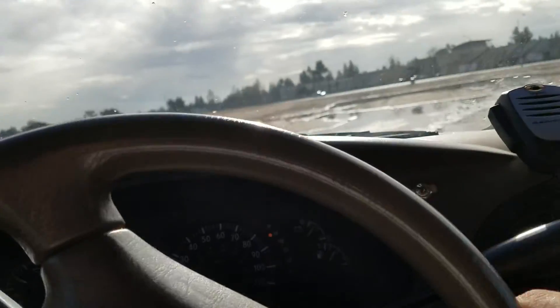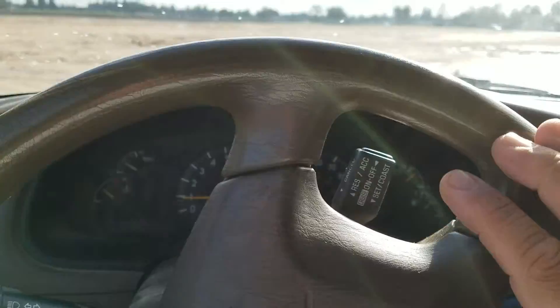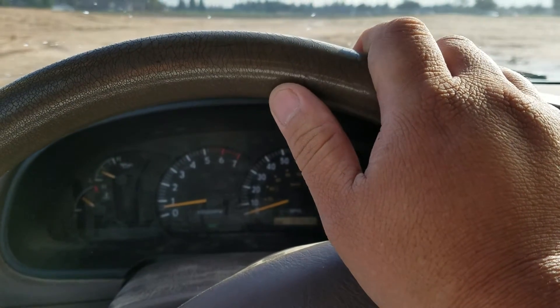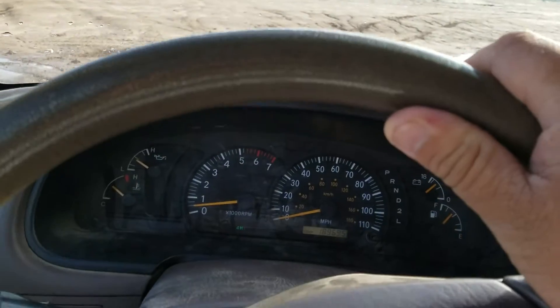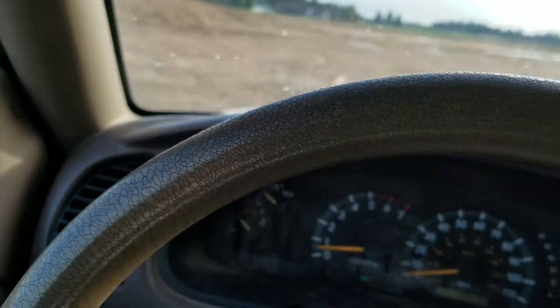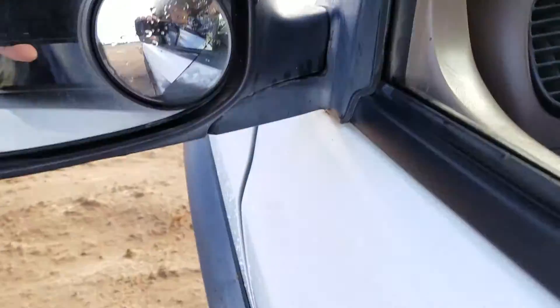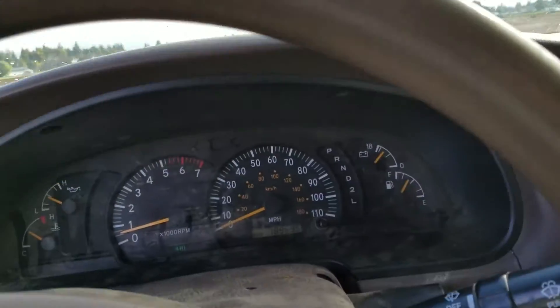Which is okay because that's how it should be. I'm going to step on my accelerator trying to do like a jackrabbit start, but this time I'm holding the steering wheel. It's not that bad — it's controllable. Watch how the dirt's going to get flung on this side. So you see that — that means the driver's side is working and the passenger side isn't working, which is what I wanted.